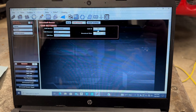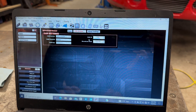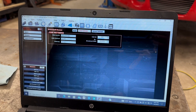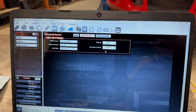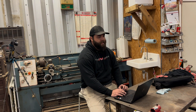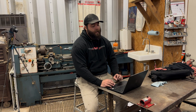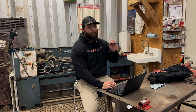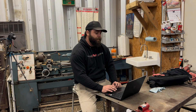Now go to CAN settings. The CAN ID for mine is 1541 — with the CAN-IO module, every single module has a different number. You take the module, look on the back, it should have a four-digit number on there, and you just enter that right here. The last thing is your broadcast rate. I'm doing 50 hertz, which is how fast the information is actually sent. For something like triggering a fan, one or two hertz is fine, but for a driveshaft speed sensor we want that data sent quickly — 50 to 60 hertz is what you want. Now let's go to the car and plug it up and see if we can make the driveshaft speed sensor work.